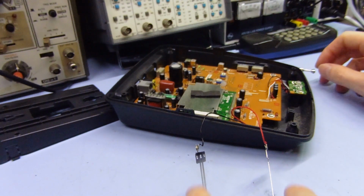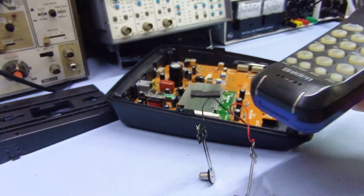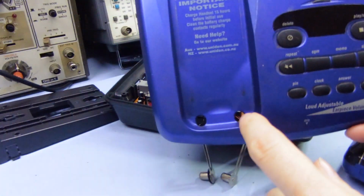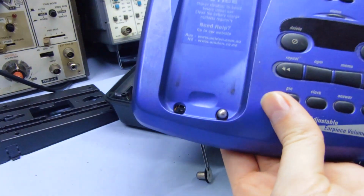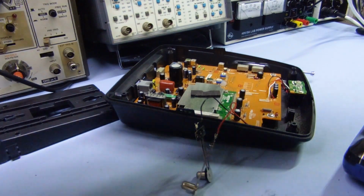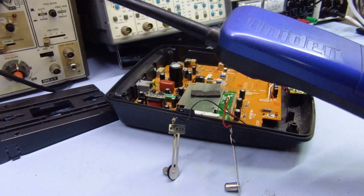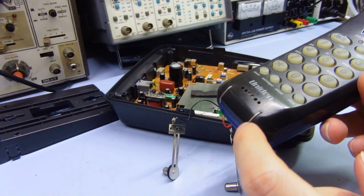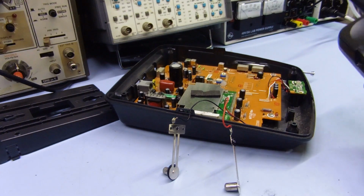Anyway, I got a problem with it, which has been occurring for some time, which I've only just now bothered to do anything about. So, as typical with cordless phones, it has charging things on here, and these connect with these little contacts here that go through the front plate, and these little holes here. So these little springy contacts stick up through these holes like this, and when you put the phone on it, they get pushed down and have some sort of tension on them from this springy material there, which all makes perfect sense. The problem is these contacts are a bit dirty now, and oftentimes what happens is when the phone rings, I think the vibration caused by the speaker in the base unit actually interrupts the connection between these contacts here and these contacts here for charging the battery, and the phone thinks that you've picked it up, and so it answers, but there's no one actually there.